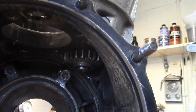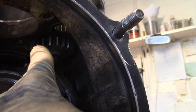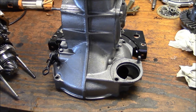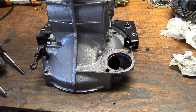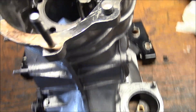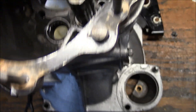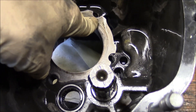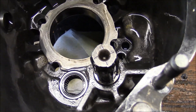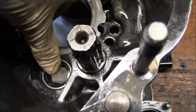When you're trying to get the reverse gear lined up, you can reach into the case and turn the idler gear to get the splines lined up — that will help you too. Have your transmission case sitting on the bench just like this with the top of it towards you. When you start to put the carrier assembly into it, first you've got to guide the studs into the pinion bearing plate holes. Next, guide the main shaft into this hole.